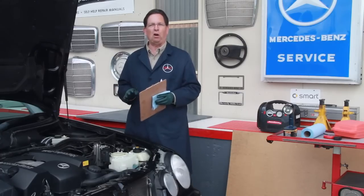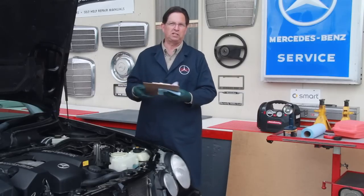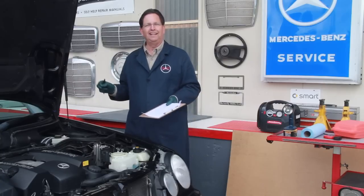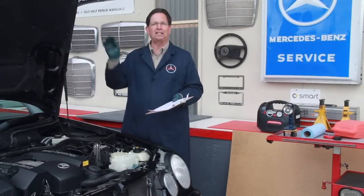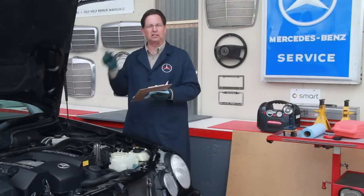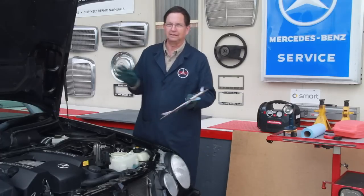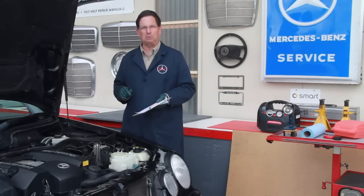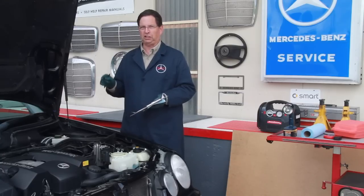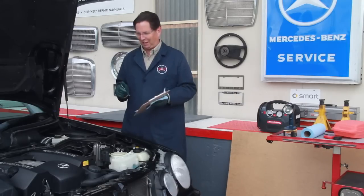But I really want, along with my fluid inspection kit, to have some test strips so that you can just dip it in the brake fluid, dip it in the coolant, and I'll have some inspection pads that you can use to inspect the transmission fluid and the engine oil for heavy oxidation. But that's coming. That's something I want to be able to offer people, because you want to really check this closely, particularly on these newer Mercedes with the sealed for life transmissions.